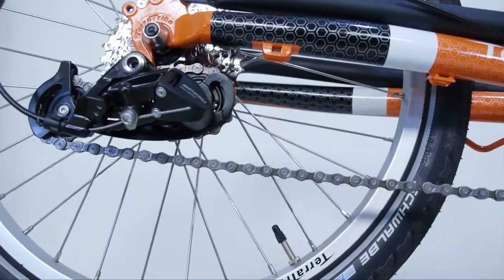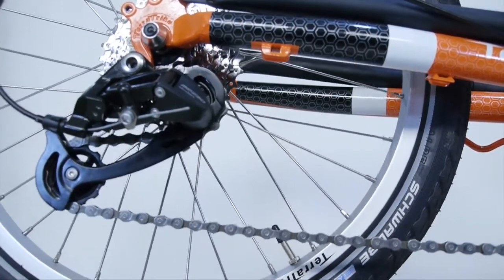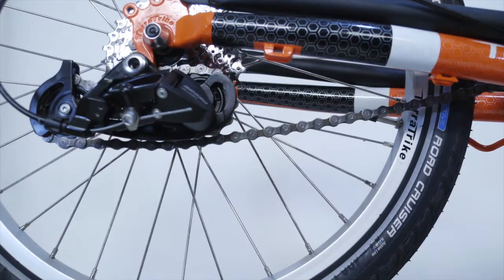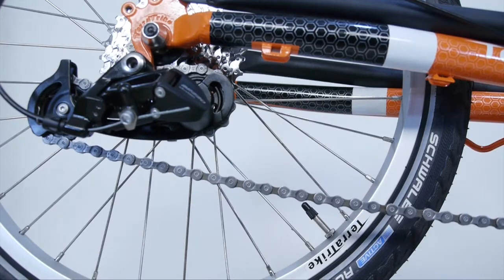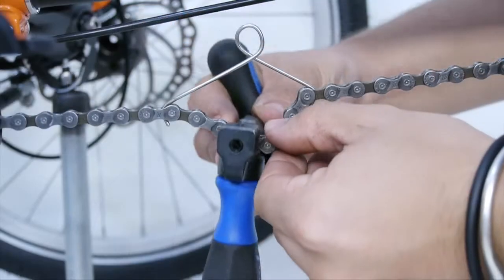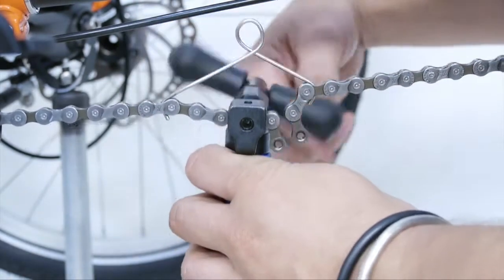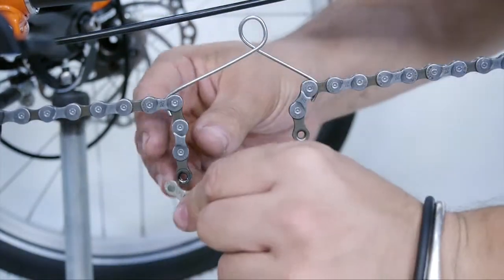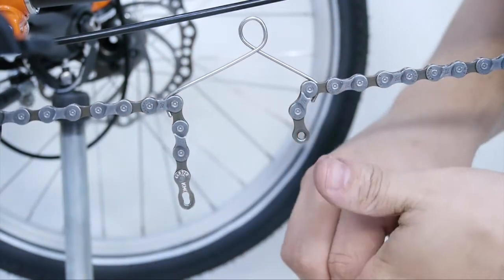Pull the chain together until a slight bit of tension is achieved at the guide pulleys of the rear derailleur. Verify that the return part of the chain does not contact the chain running through the upper guide pulley of the derailleur or tensioner. Identify the closest chain length that achieves the desired tension and cut with a chain tool. Install the quick link and snap it into place.